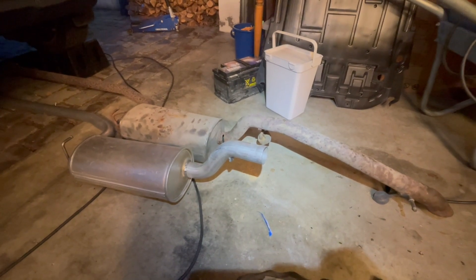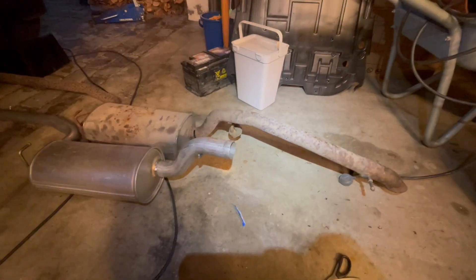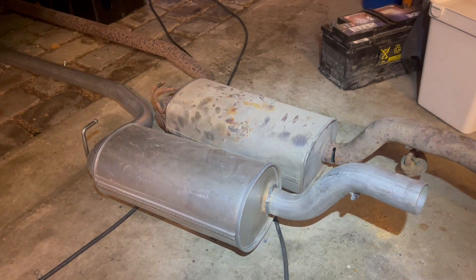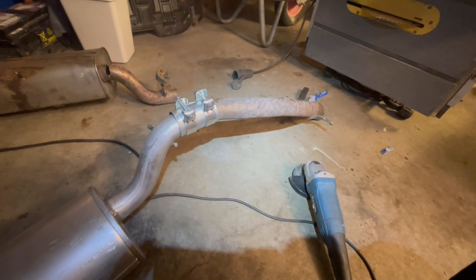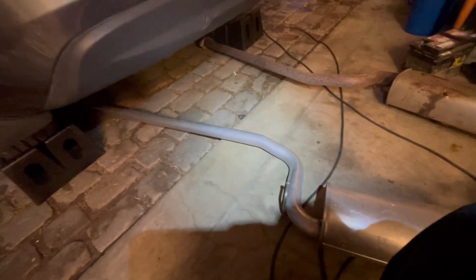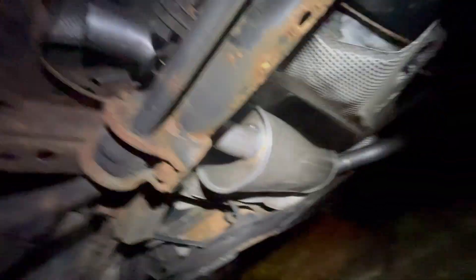The replacement exhaust is not exactly the same as what was fitted in the car, which was actually good for me because I would not have been able to get the original-length exhaust back in without a lift. That meant I needed to cut off a little bit on the new exhaust, transfer the end from the old exhaust, and then use an extension clip to join them together. I also needed to cut the new exhaust so the mating surfaces are flat and straight for the adapter to fit properly — if left uncut it would have a slight angle to it.